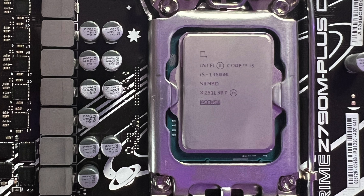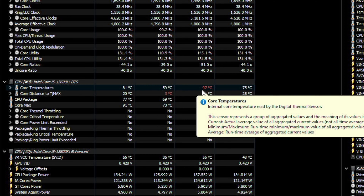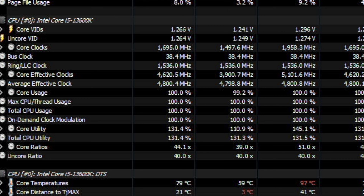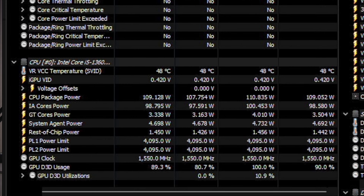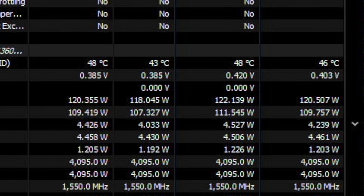Let's talk about power delivery. The 13600K consumes just as much as the 12700K, meaning it eats a lot. The first test is 8K video encode — we slammed both the CPU and integrated GPU with a heavy workload. On the Asus motherboard, HWiNFO reported 137 watts of CPU package power with a 4800 MHz clock speed and just 58°C on the VRM. We observed almost 50°C on probes directly attached to the MOSFETs. The 8-degree difference is due to the design — these smart power stages are flip-chip, meaning they're much hotter at the bottom where the temperature sensor is than at the top where the probes were. For video editors, results are even better: 110 watts package power at 51°C VRM. Gamers rejoice: 122 watts of power and 52°C on VRM. The board can handle normal life tasks no problem.